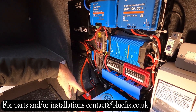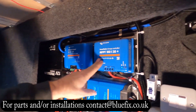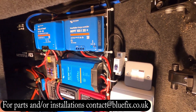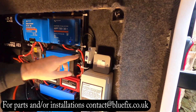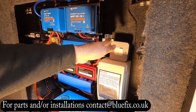This is what we're giving away this month. We've got an Orion which charges the leisure battery while driving, an MPPT which charges the leisure battery from the solar, and we've got a mains charger here — an IP22 — which is tucked into this fused switch. This breaker here is for the solar; you should always be able to isolate the solar coming in, so we use one of these DC breakers.